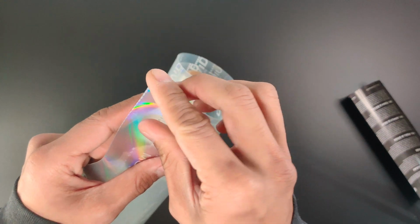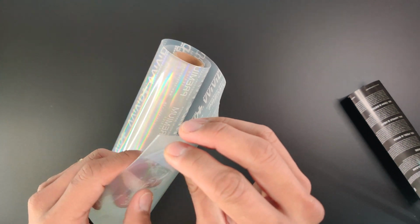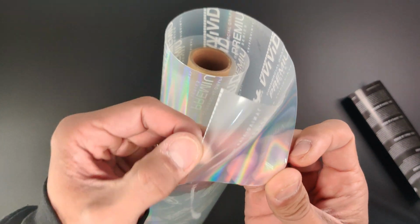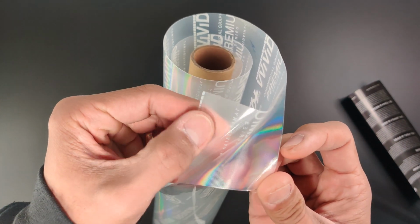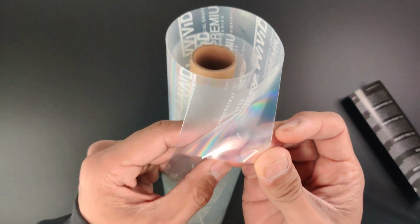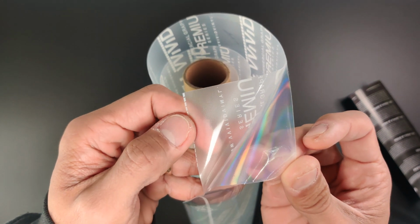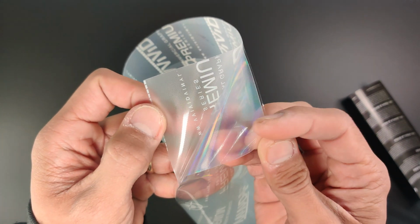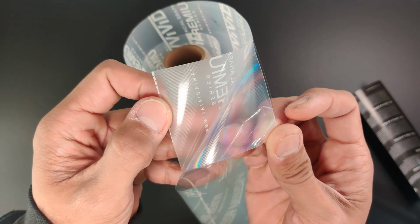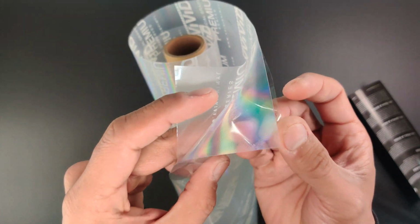All right, so it does have the protective cap. You'll notice that on this, the backing paper is not a backing paper, it's a backing plastic now. With this new Ultra Gloss, it's a new plastic. And I can see and feel that the air release pattern is different than standard previous VVivid vinyls. This one has, you may be able to see in the camera, very small diamond-like patterning on it. Other VVivid air release channel patterns are more of a dinosaur skin, and I'll show that to you in a comparison here to another VVivid clear headlight tint.